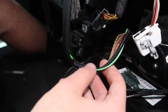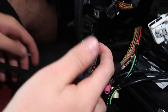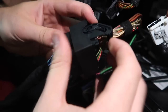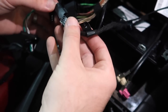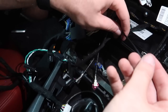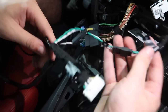Now that we have the fiber optics pulled out, grab the new harness and put it in the exact same orientation - same spot, same orientation. Now connect this to the harness - pull on it down and it should click in nicely. As for the 4-pin on the harness, there should be a connection for a 4-pin right over here, so connect the 4-pin connection - this is for the iDrive controller. This next one is for the microphone. Go ahead and find the microphone connection - I believe it's this two-pin. Yeah, two-pin microphone connection goes right into the harness.